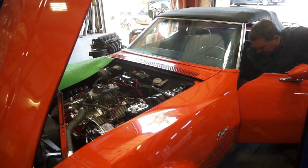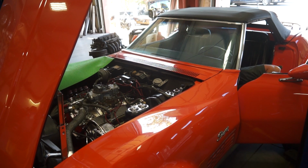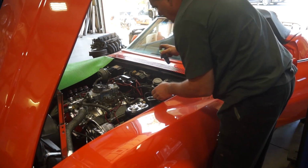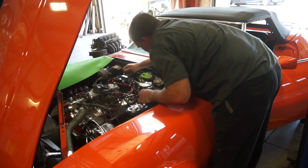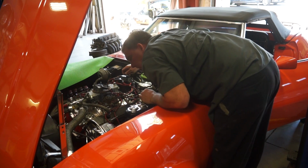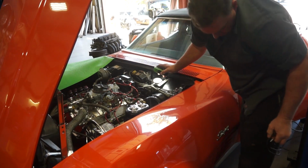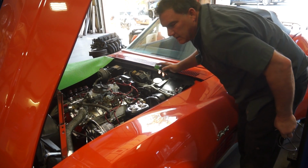Oh, Mikey's down with all the mouse poo. Fine. And mold. Better. Oh. Ouch. Alright, all my fuses are good. So that makes me question this guy right here. Wonder if this has an ignition bypass on it, like a home-built security system. Some of these had a lock cylinder drilled right in the fender for that. Normally that would interrupt the starter.